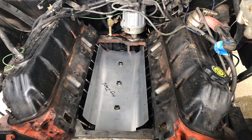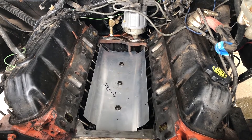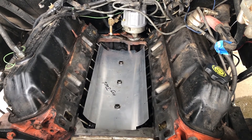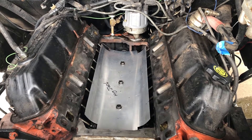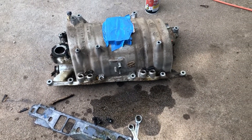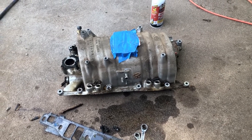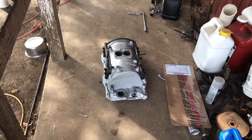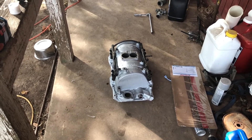There's folks out there who call it snake oil — so be it. You can go out and buy yourself the big block valley pan and trim it to size, or just go to Utah Awesome and order one that's already pre-bent, drilled, and trimmed and ready to bolt in. It's especially nice for towing applications to get some of the heat off the intake manifold. When I go to lift the fuel rail and injectors out, I tend to hose down the bungs with penetrating oil to make them come out easier, then hose them again and they slide in nice and easy.